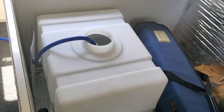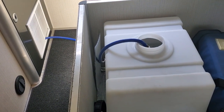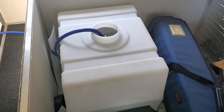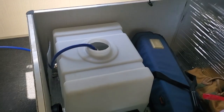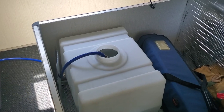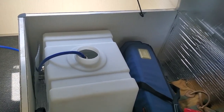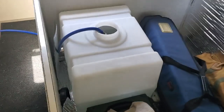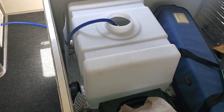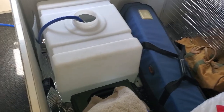This was a big deal — this is a 30-gallon water tank with a hose that goes across into that area. Mike from ATC figured this out per my request. When I winter camp with this, the exterior tanks are not well insulated. I also got the heater option — heat pads on all the external tanks — but there's no way to keep a 100-gallon tank on the bottom of this trailer from freezing. So I made it so I can take 7-gallon blue jugs and just pour 3 or 4 into this at the start of a weekend, conserve water, and use the pump — because I can't find campsites in winter with active water.